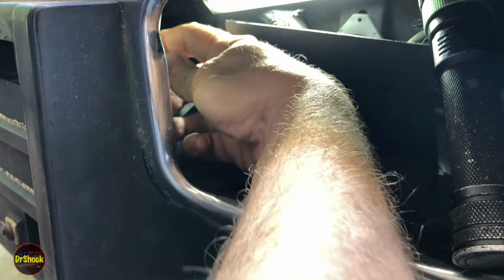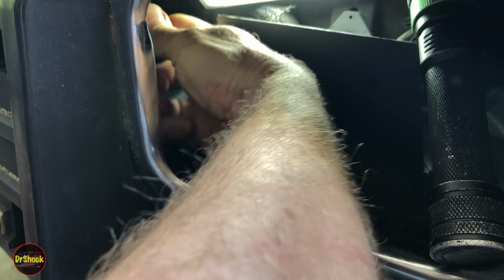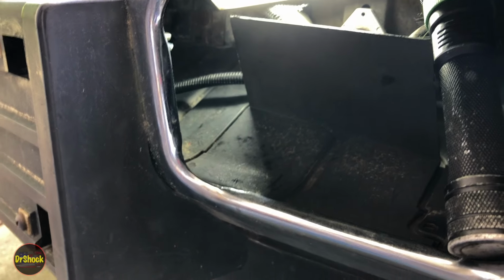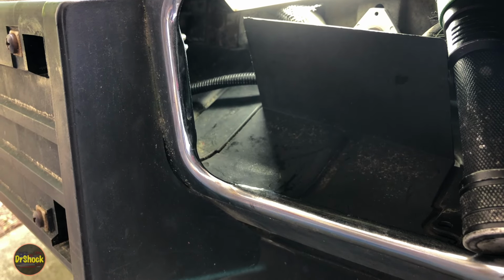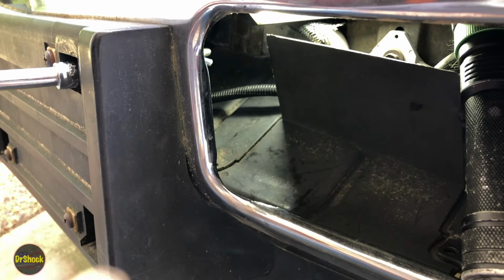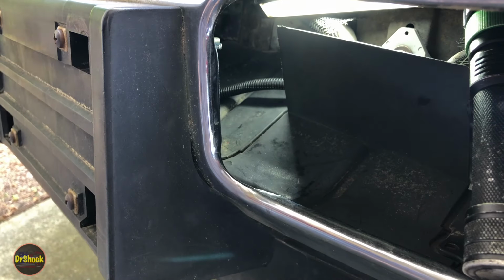All right, you reach your hand through on the other side of the nostril. You can hold this whole heat sink into position while you tighten this guy up. Just like that. There's no torque value on this because this is just something we're doing aftermarket. And it's just necessary to do this kind of aftermarket thing given how often this particular component is going to fail. Put a 10 millimeter back up here to hold it. And just tighten it. Hand tight. And that is it. We're done.